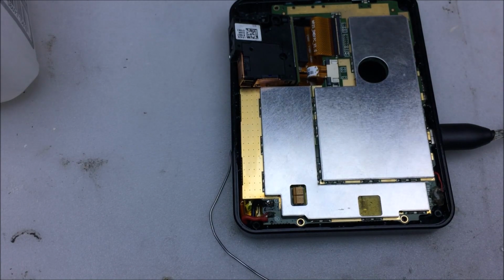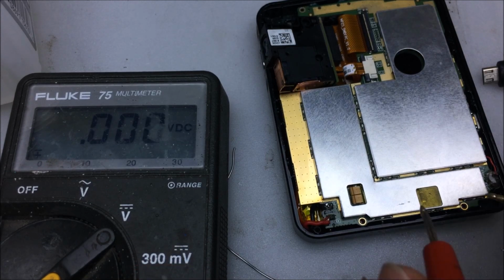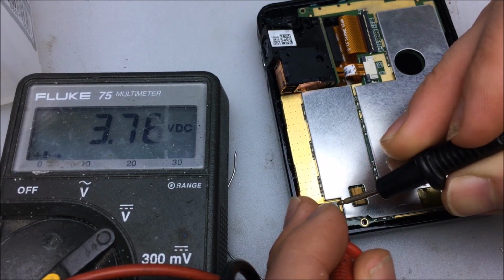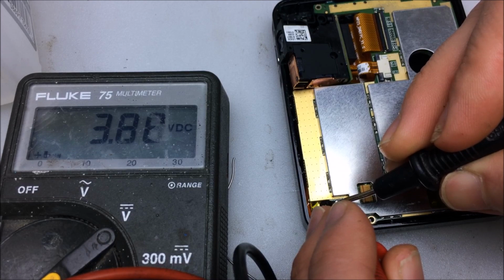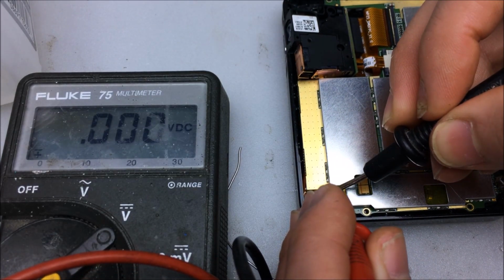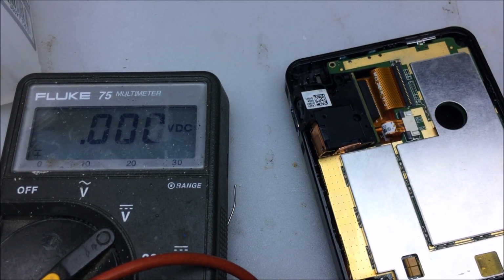All right, let's check to see if voltage is higher with the charger plugged in on the battery. So, unplug. Maybe like 3.7, 3.8, maybe 3.9, not fully charged. 3.75. All right. Plug in. 3.75. Oh, yeah, we got a higher voltage. So it is, in fact, charging. Take a look, see if it goes back to 3.75 with it unplugged again. Oh yeah, we gained some voltage. Okay, cool. I'm gonna let this charge on its own for a little while, and we'll get inside of this, but it does look like it's a successful repair.